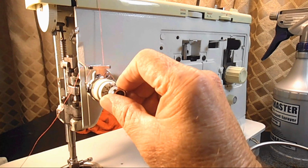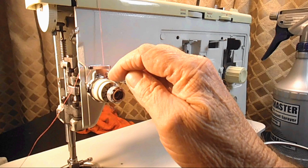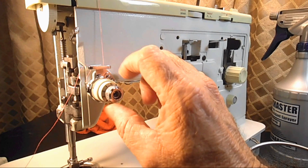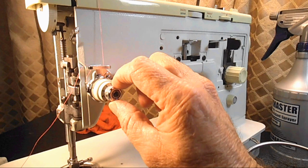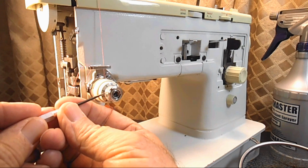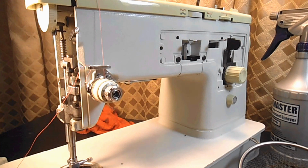But anyway, you're going to put that on. For me, the same story. Sometimes if I start it left, it'll help line it up. And then I'm going to tighten it up against the indicator dial without adding more tension, without turning that flange adapter anymore. I just want to get it up against that. Okay. So in this case, my set screw ended up over here on the side. So I'll come over here and tighten that now. Right? And then I'll test it.